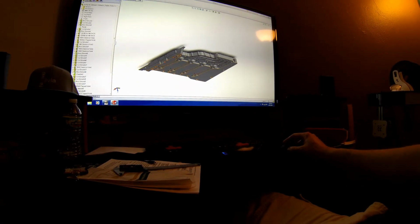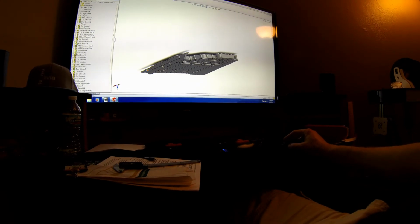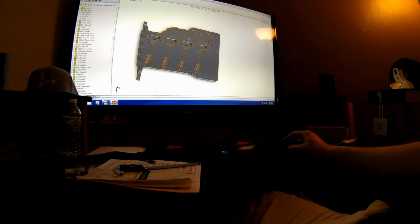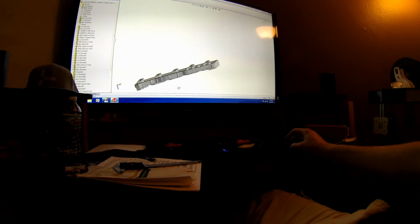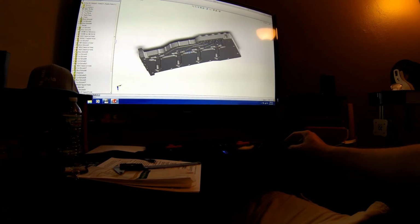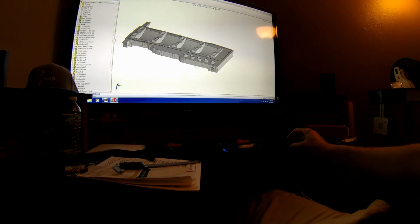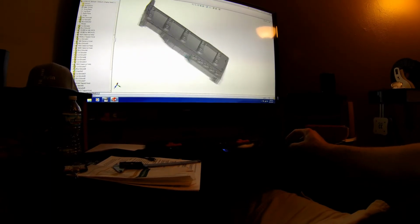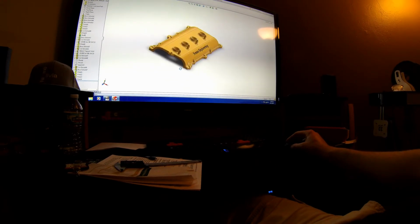There's the bottom piece I designed. There's a piece for the Z32 transmission that bolts right here, and then it has holes where the transmission actually bolts up. There's one, but there's three other ones for the transmission to bolt up. And then there's the oil passages for the dry sump pump, one for each section of the block. And the block will be completely sectioned off, as you can see from these. These go up to where the main caps are for the bearings, and then the pump will sit here, and then there'll be a pickup for the pump from the oil tank right there.